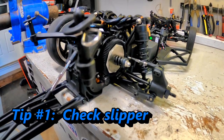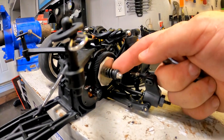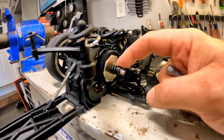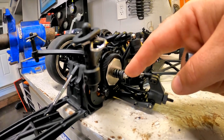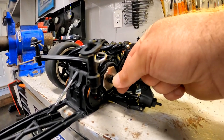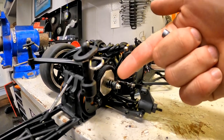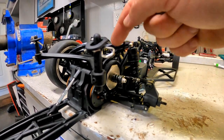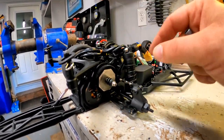Item number one on our checklist is checking your slipper clutch settings. These are very important in a drag car. I was actually really surprised to see that it was so loose — all the way out at the very end. That's a very stiff spring they provide in here. What I did is I turned this all the way in and realized that mine was set from the factory at exactly six turns from all the way compressed. My initial runs have shown that's probably slightly tight, and it could benefit from a quarter or maybe up to a half turn being backed off. Just check to see where it is because the slipper settings on these drag cars is so important — you want to know your baseline when you go out and do your first runs.